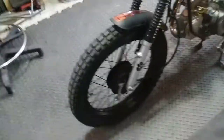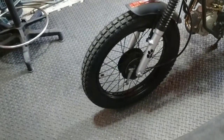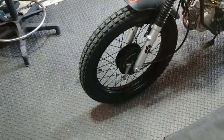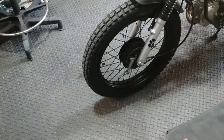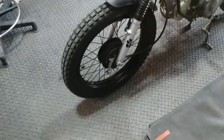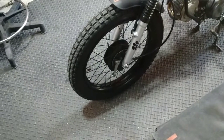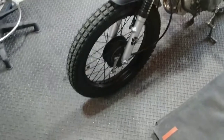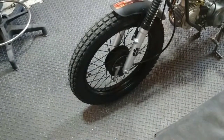There is a problem with the front hub. At the moment it's running the original C90 wheel and hub, but the brake hub that fits in is from a CT and they don't properly match. The wheel works at the moment, but it means the worm gear for the speedo doesn't work. I need a CT90 wheel — I've got various other wheels but they're all 18-inch and these are 17-inch wheels, and I'm going to keep them that way.